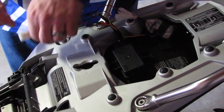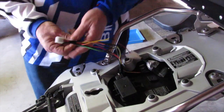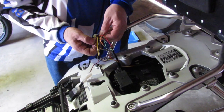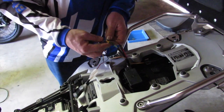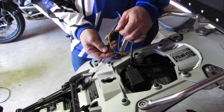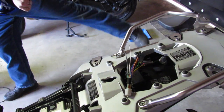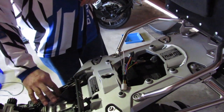We've got the whole harness wired now. The smart switch plug has two outputs and two inputs that are not used on this installation. We have the remote enclosed in plastic to keep it watertight. We've got the power coming in already connected to the battery with the inline fuse, and we have the left and right spotlight coming in on the brown and orange wires of the smart switch. We also have the remote and the brake light wire. All of this should be good once we connect it to the smart switch.